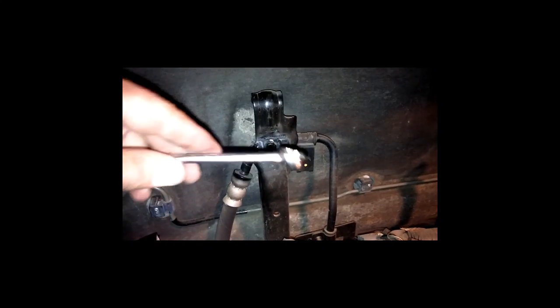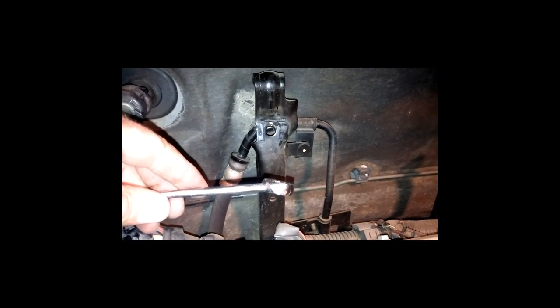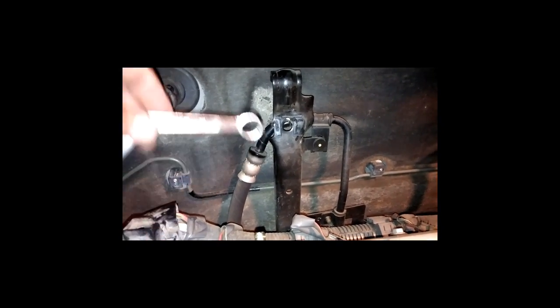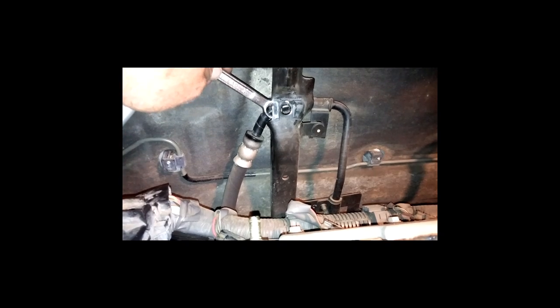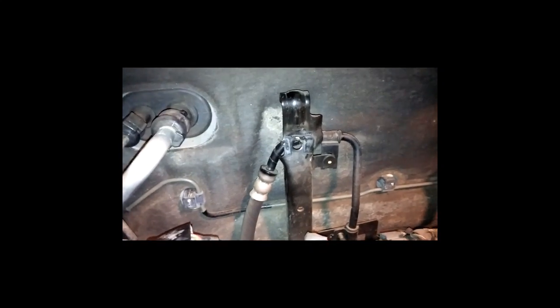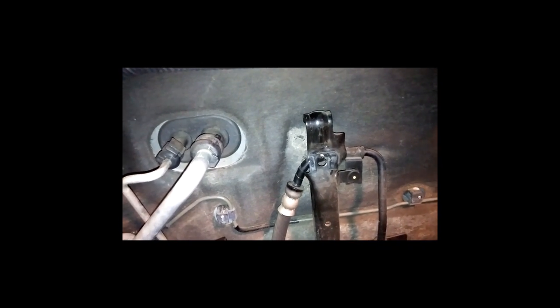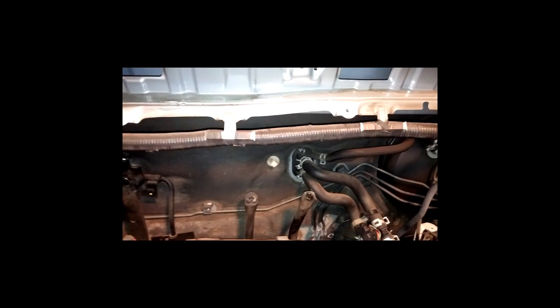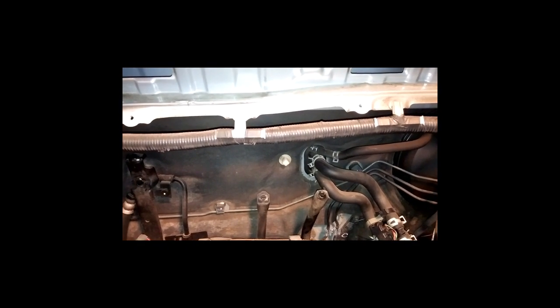And I used a cheap, was it made in India wrench, mainly because it was a little thinner than the other ones that I had. So sometimes the cheap wrenches, you know, come in handy for some stuff. But I was able to get it at this angle. I moved it out. I was able to break it loose, get a few turns on it. Then I went in there with like 2 fingers and did it. It was not a lot of fun, but it's doable. These over here, with the 12 millimeter, I was able to get this one here off with a socket ratchet of a 1/4-inch drive.